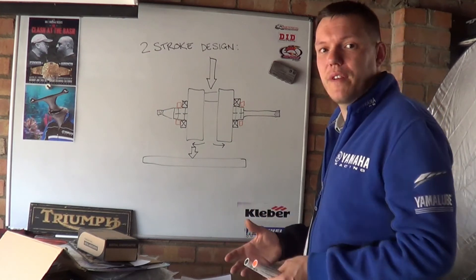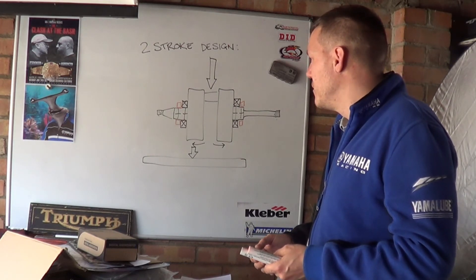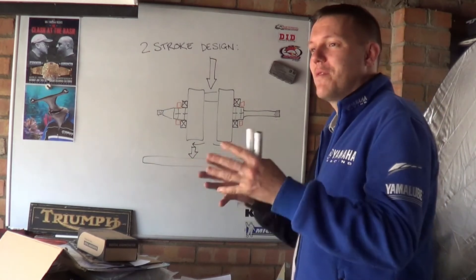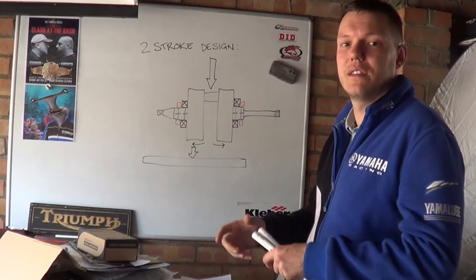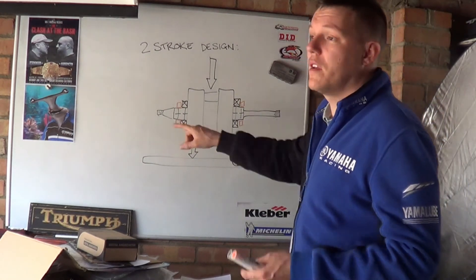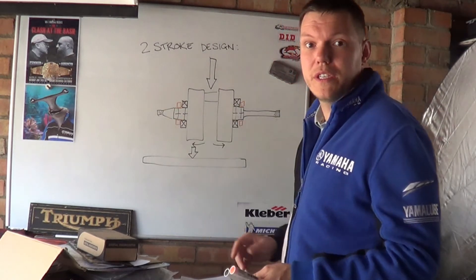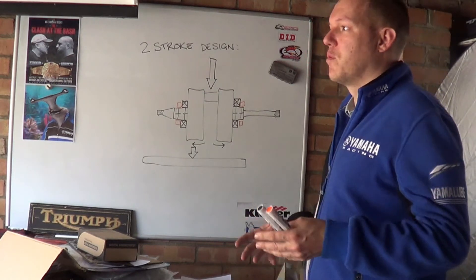Things are more likely to catastrophically break. It would be an excellent idea if we could do that. There are possibly some solutions to this, and I will do some videos — I need to do some sketches and some CAD work so I can fully show you how this works. I'll also do some failure analysis and yield simulations so I can show you the forces. I'll literally measure up an actual crankshaft, stick the bearings in the correct place, and then stick the bearings outboard, and we'll see the differences from the simulation showing how force is spread and distributed and what could be a possible failure.